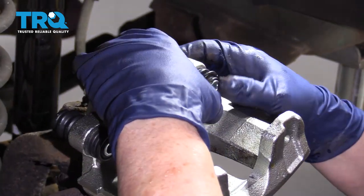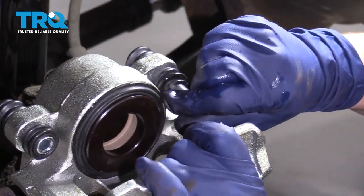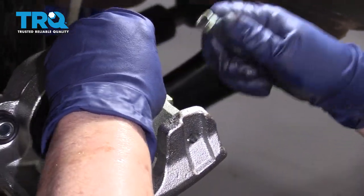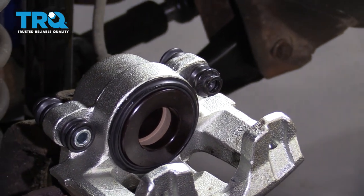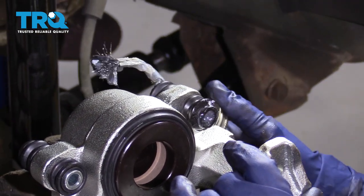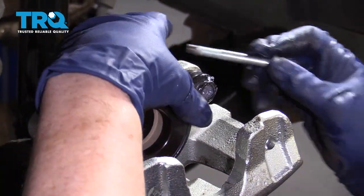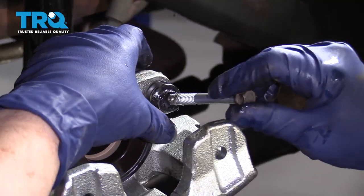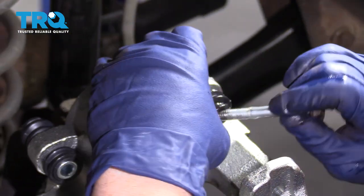Even though it's a new caliper, I always make sure they put enough grease inside the caliper slider pin, because you just don't want it to break down on you. I'm going to put a little bit more silicone paste in there. What I like to do is cover the hole up on both sides — I could use a flat-head screwdriver but I'm going to use the old mounting bolts. I'm just going to make sure it's inside these grooves of the boots, because that's what's going to keep it sliding in the future — it will take that paste as it heats up.